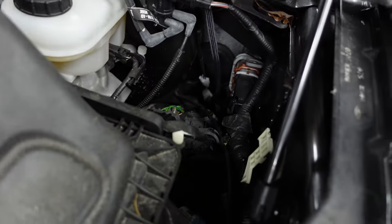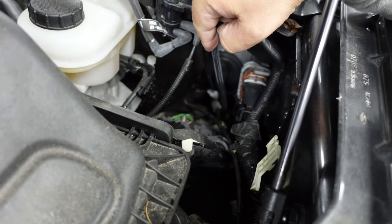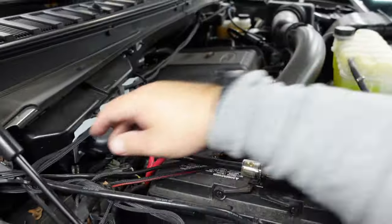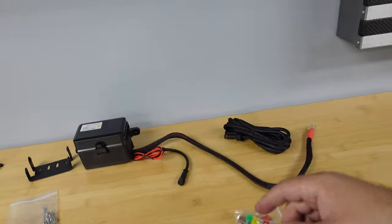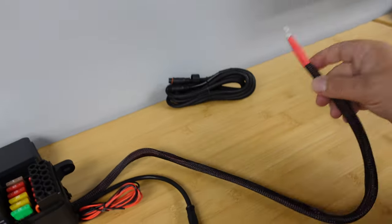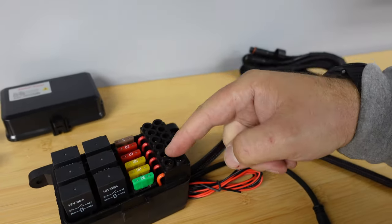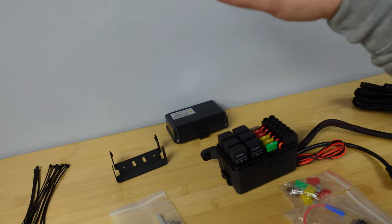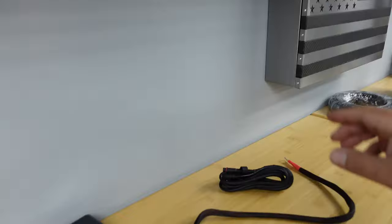This will be everything I need and it will be maxed out. I don't envision adding anything else — I've got six different light switches and I don't need anything else. Anyway, let's see what the wiring will look like. Right in here is where I was able to fish those two wires through the firewall, and they run across the front. So I'm going to remove those. This is the new switch panel — it looks relatively easy. We have the power cable and then you can wire all the different lights to this actual box. Obviously you can choose what size fuse you want — they give you all the fuses. This wire runs into the dashboard that plugs into the control.